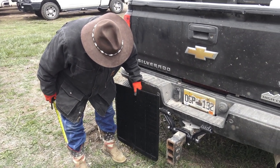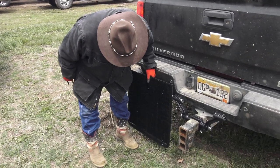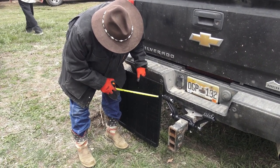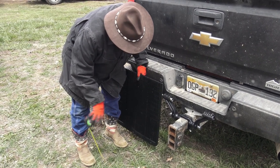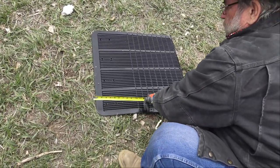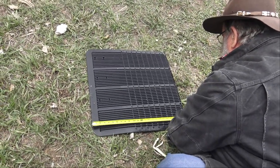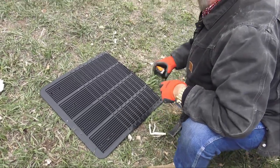According to my calculations, I need to come up 14 inches. It dropped less than an inch with that trailer on there, which is very good for a living quarters horse trailer. So it looks like where we want to be is on the 4th hole. Which means the cut line will be right below that hole — right above hole 4 is where we're going to cut the mud flaps. My calculation was 19 inches, and measuring the top of the 4th hole, that's 19 — it's like a half inch off. So that's pretty accurate. My measurements are pretty darn close.